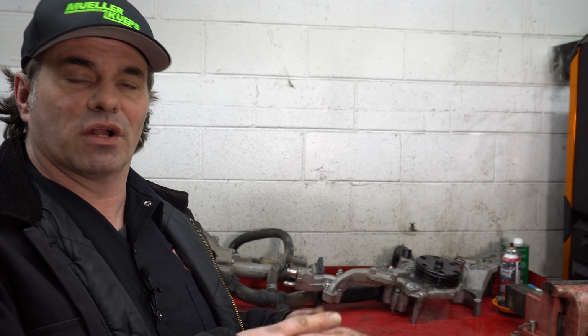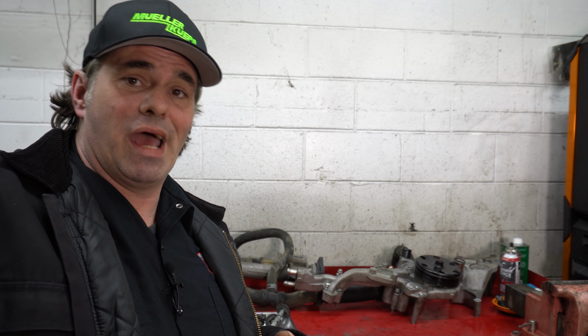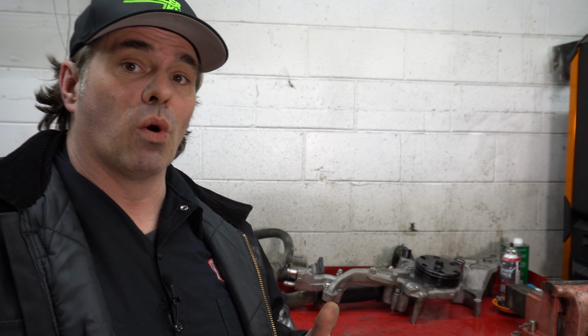Normally what I do if I'm working and I don't have a workbench available, or it's got stuff on it, is use the space between the bays. The furthest point away is the first thing I took off, and then I work my way up, usually until I'm about to the front tire, and that's where the last part I took off will be. And then you work your way back. That way, instead of having a pile of parts and wondering, did I take this bracket off first, you've got it set up so it's organized and you can just work your way back to a driving car.